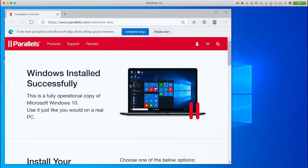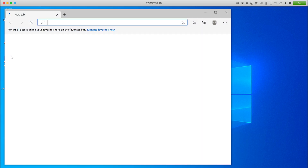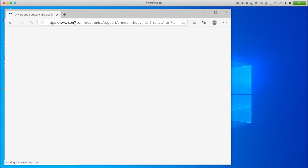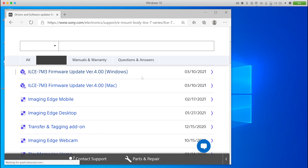At this point it will expand the window and you just use this as a PC in that window. Open Internet Explorer — which is known as Edge now — and go to the appropriate link for the camera that you have. Most are in the description below, but if you can't find it there, just Google it. Remember, each firmware updater is specific to the camera model. I'm updating the A7 III, so I'll go to the A7 III link. Remember, this is for the Windows updater and not the Mac updater — you're running that virtual Windows PC on your Mac, so you need the Windows software.